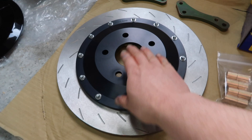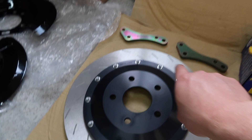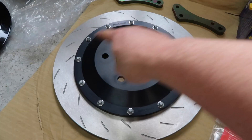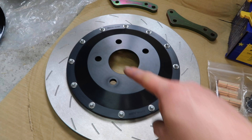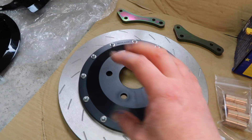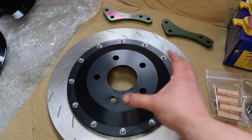We have this big old brake disc right here. This is part of the big brake kit from Rayland Motorsport. It comes with two discs, which are larger than stock, and two brackets to adapt — basically to move the caliper up a bit to accommodate the larger disc. The construction of the disc is an upgrade over stock. It is a two-piece disc, meaning that we have our steel rotor bolted onto an aluminium bell which is lovely and black anodized. The fact that this is aluminium and the bell is reasonably large because it is a conversion kit, this is actually lighter than the stock disc, even though it is larger. So that is pretty awesome.